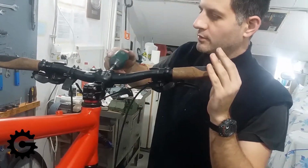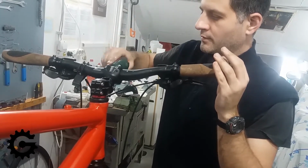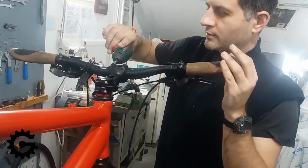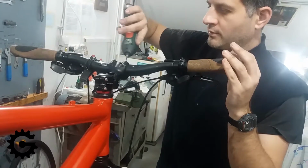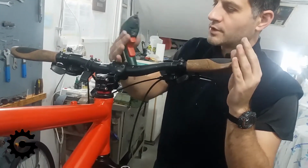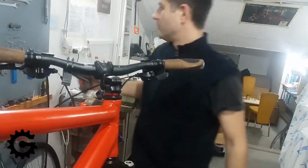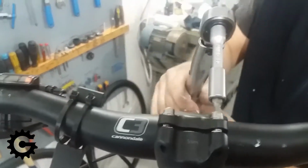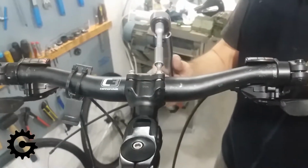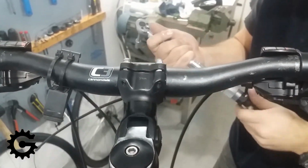This tool is precisely set to a maximum torque of just about 4 Newton meters, and in this particular case I can surely rely on it to give me the optimal torque for tightening, because it will not overdo it, and since the bolts are lubricated with some anti-seize. And for this demonstration here, I'm using this. The safest thing to do is to use a torque wrench.